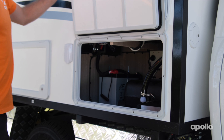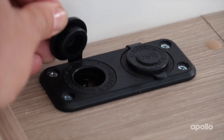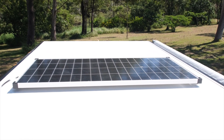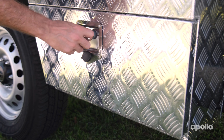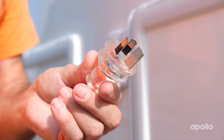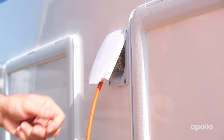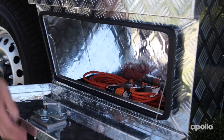Your adventure camper has a 12-volt house battery that runs the water pump, lights, and fridge. All the 12-volt switches can be found at the control panel. It also powers the 12-volt outlets and USB charging ports. You'll see the remaining charge of the house battery there. When you are driving, the engine will charge the house battery. There's also a solar panel on the roof that feeds the house battery. If the level is getting low, plugging the camper into mains power will fully recharge the battery. To connect to 240V mains power, you'll need the lead from the storage compartment. The lead has a large earth pin, meaning it's rated at 15 amps — you can't plug this into a normal power outlet. All campgrounds in Australia will be rated at 15 amps. Make sure you have a solid connection with the large earth pin at the bottom. Make sure the circuit breaker is in the on position. Turn off all appliances prior to disconnecting from the power inlet, and always remember to unplug your RV before you drive off.